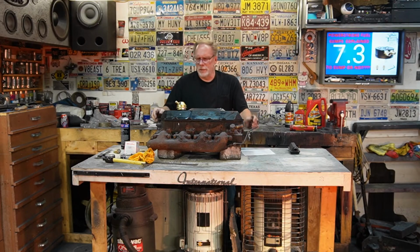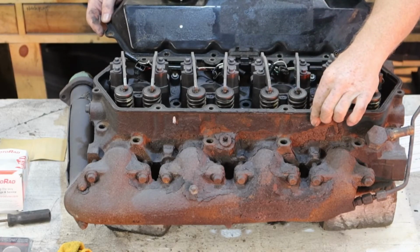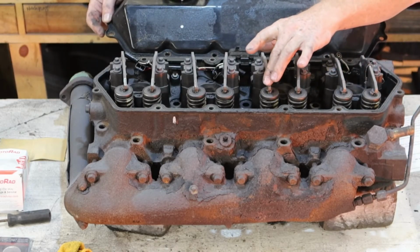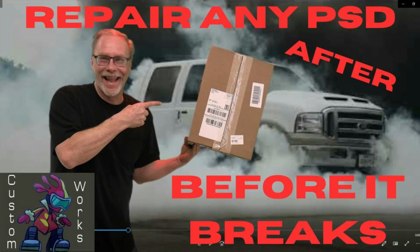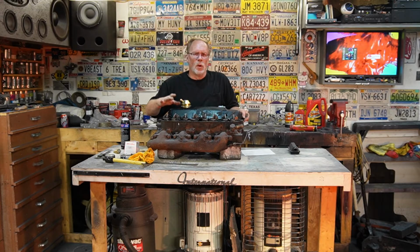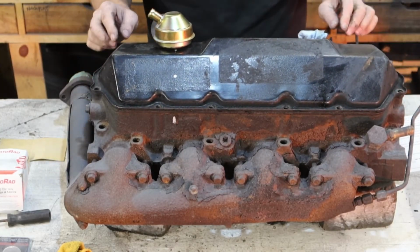While you're inside here, it's a good time to take a look at your wiring harness. Make sure everything is nice and tight. Real good time to make sure that you check your valves and your lifters and your rods to make sure that these are not ridiculously loose. That way you can prevent an issue right away in the future. You can see if the push rod is bent, or if this is worn down, or if the clips are worn, and get it handled right away, and she'll run much, much better. But either way, get her reinstalled.